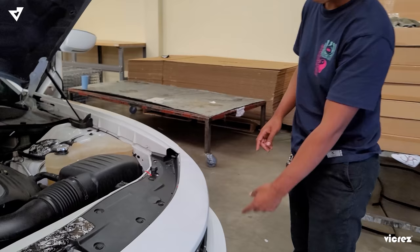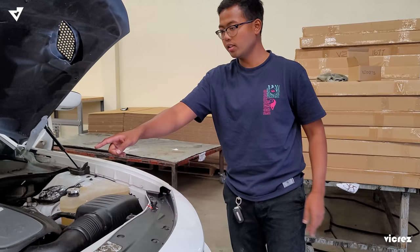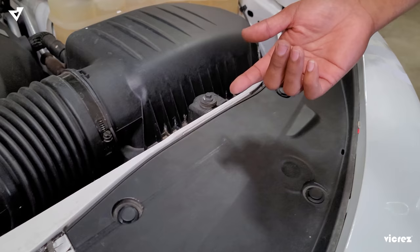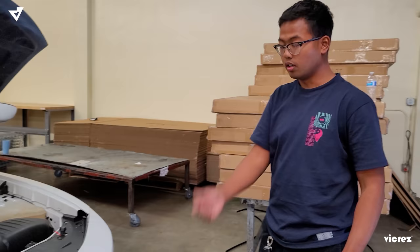It is optional if you want it to be amber or not. If you want it to stay white the whole time without turning amber when you signal, just leave it, ground it, and plug it into the brown and white or orange and white on the passenger side and you'll be good. But if you did want it to be amber, you'd have to get the yellow wire — which you'll see when you open the package — and tap it into the white and green. Then it'll turn amber whenever you signal.